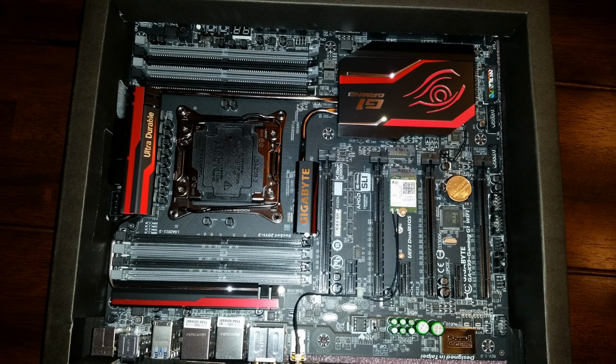At one point I had it to where the computer was up and running, I had Windows on it, I could boot it up and down with some limited USB drives connected to it. But other than that, it just wasn't super stable. And whenever I connected a second monitor to it, it would not boot into BIOS at all. It would get hung up and just wouldn't go. So that's definitely an issue there. I pointed out the Crossfire cable they gave me that had a hole in it. That wasn't a good thing. There were several times I tried going into BIOS and it would get hung up. Overall, I just did not have very good luck with that board.